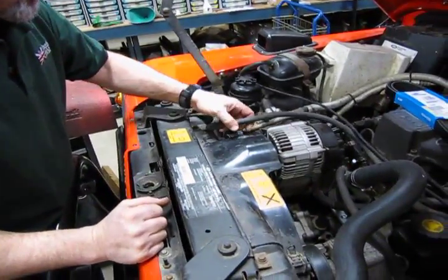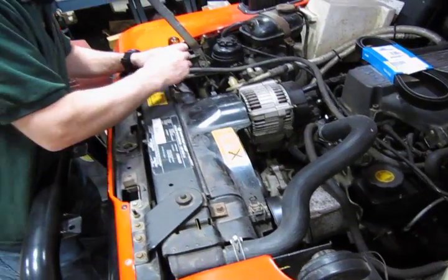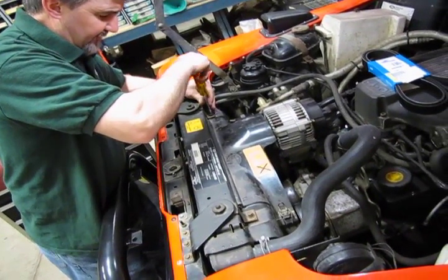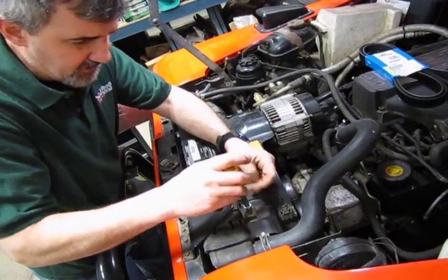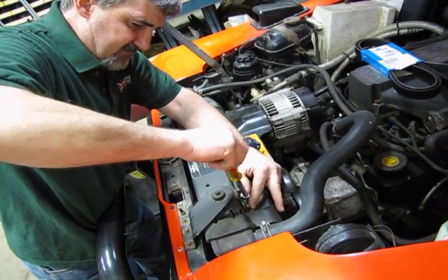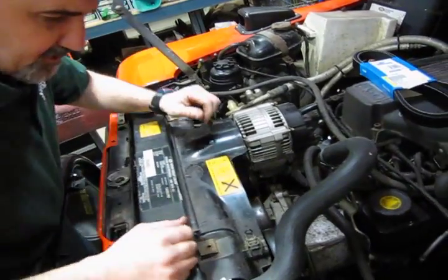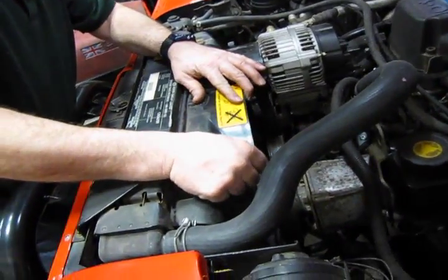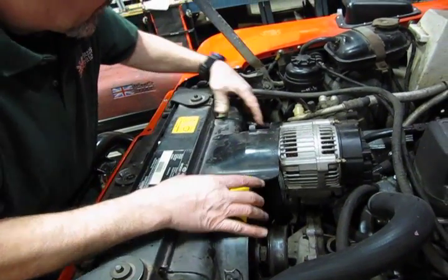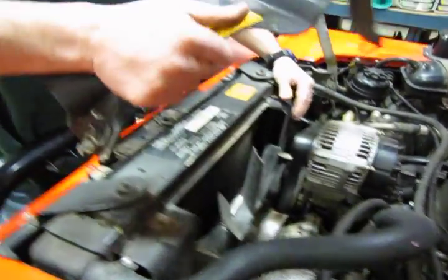First step, we're going to take this upper coolant hose. That'll just slide up out of the way very nicely. You have two bolts that run down through the brackets that support the fan shroud. Normally 10mm heads on the two. And the center section of this upper shroud is just held in place with two clips. One here, you're just going to lift up, release that clip. Down on the other side you have the same style clip. You're going to roll this forward so that it clears so you can lift straight up and out.